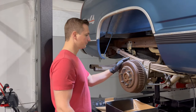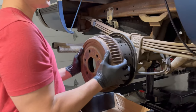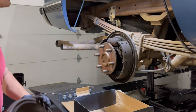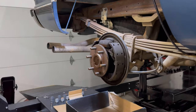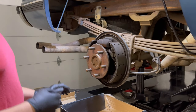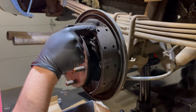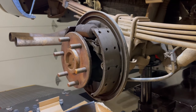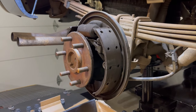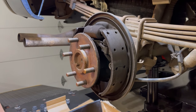The first step is to remove the drums — these weren't too bad. Sometimes you have to beat on them a little bit and pry at them. As soon as we take a look in here you can see all of these cracks in the shoe itself. We've got a crack here and a big crack in the shoe here, so these brakes are just really old and in need of a refresh.